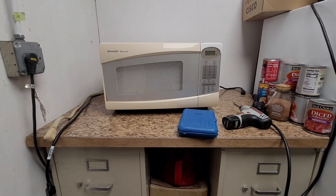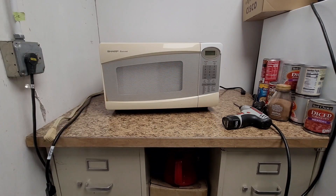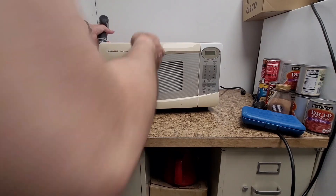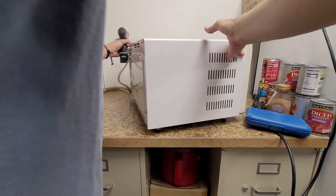Anyways, now that I've killed this video — this is the microwave I use in my office, and it just died as of recording this. I put food in it, hit the start button, and heard basically a high voltage noise, and then everything went dead. I'm kind of curious to see what failed. I'm guessing it's not going to be visually apparent. I'm going to speculate that maybe something shorted out inside the magnetron. But there's only one way to find out.